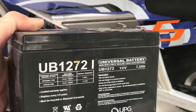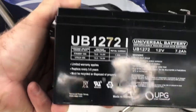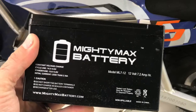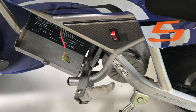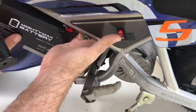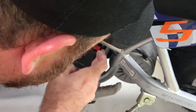If you're looking for the type of battery, it's a UB1272 — I actually have replacement batteries. I picked these up on Amazon, a pair of them, I think they're around $30. I will post a link in the description. Now I'm going to try to slide the new battery in place without actually connecting it first and then connect it afterwards — it seems to be where the most room exists. Let's get the steering out of the way, push these wires up, slide this under. It's a kind of tight fit, but it can be done. There's one, and there's two.